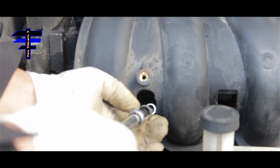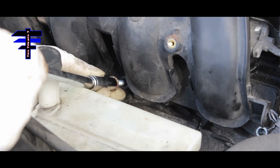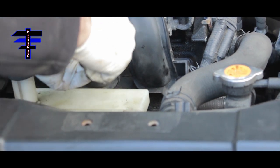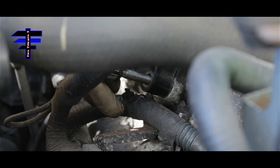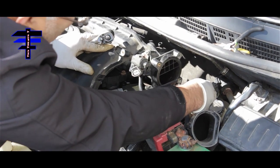Put the bolt in there, get it in nice. Third bolt, fourth bolt — make sure it goes in nicely. Once everything is aligned, tighten everything now. Use the 10mm socket and ratchet to tighten. Don't get too tight or you'll crack the plastic. Be patient, go in nice and slow — if it feels too tight, just stop.